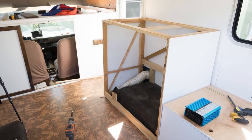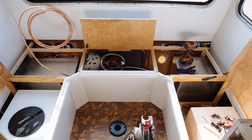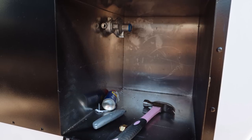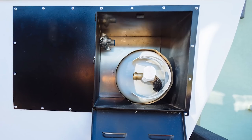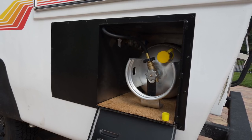After installing the frame for our kitchen on the inside, it was time to fill in the rest, and this included the countertop, the stove, and the sink. With the stove in, it was time to run some propane lines from our propane tank on the other side of Amelia over to our stove. Because we had a new box made to store our propane tank, it was a completely blank slate, so we had to install the propane regulator. Once we did that, we realized our old propane tank was no longer going to fit in this space. When the new propane tank arrived, it unfortunately had too much space in the new propane box, so we had to install some straps to keep it secured into the corner so it wouldn't roll around while we were driving. After all of that, we finally had a working stove again.